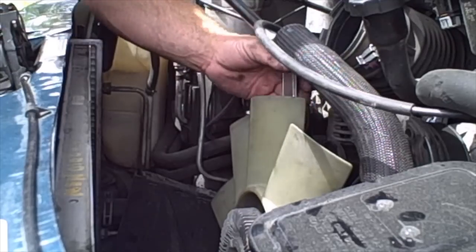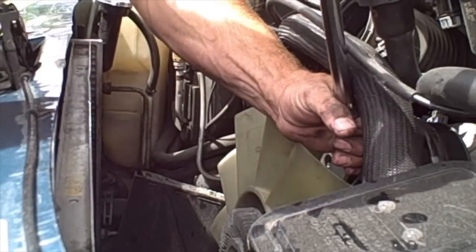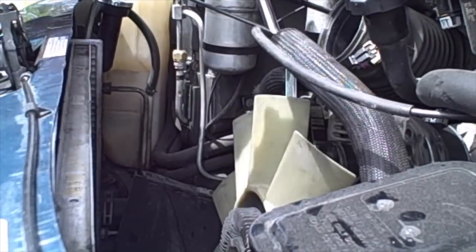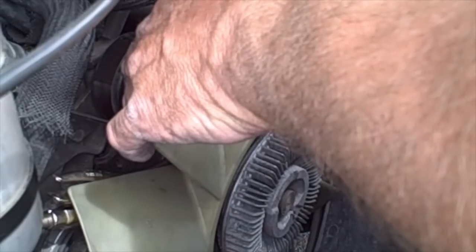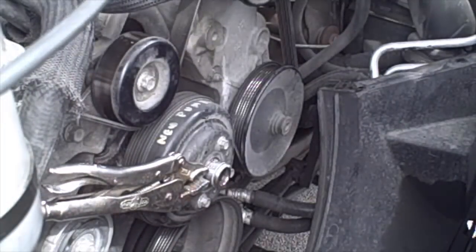I have my tool installed — I've got my extension in there and my wrench down there. I'm just going to take my hammer and get a couple good blows to break it loose. I have a vice grip on the 10 millimeter bolt on the water pump, and the fan pulley tool right here. All you've got to do is pull them together — it's as easy as that. Then just pull out your tool and spin it off. Make sure you hold the fan so it doesn't fall into the radiator. Really simple, really easy.